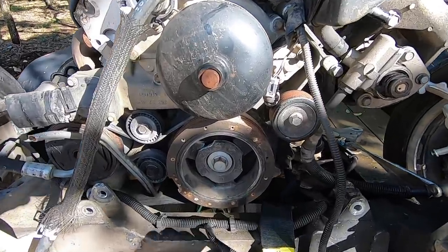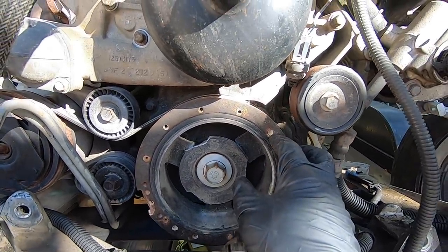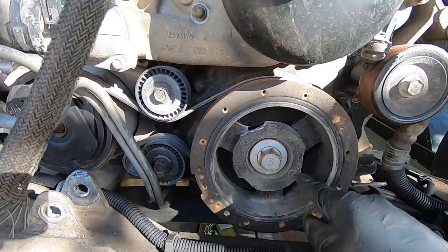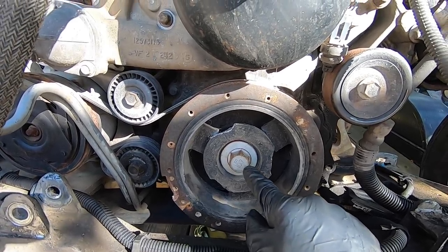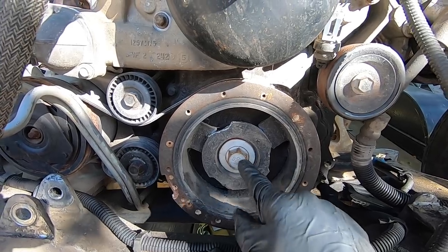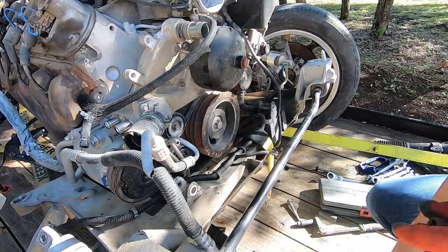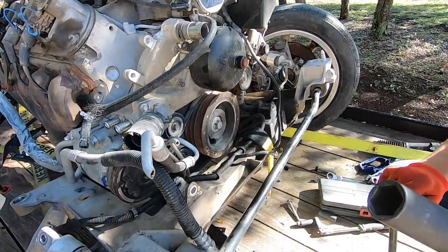Rack and pinion removal went super smooth, no surprises there. So this is what I was after — this pulley is completely broken. I noticed that once I started checking out the accessories and realized the entire pulley is pushed back probably half to three-quarters of an inch further than it should be. Very obviously, all three ears are completely broken on it. What I need to do now is remove the center bolt — this is sometimes very difficult on LS's; it is torqued to well over 200 foot-pounds. This particular one has most likely never been off, so it's been over 20 years since it's been removed. I'll just get an air impact on there and then use a special puller that's designed for LS engines.